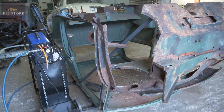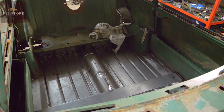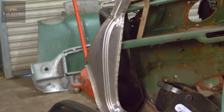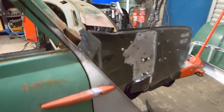While it was on its back, on its roof, laid the floor in, cleaned up all the areas on the back that had to be spot welded, cleaned up all the areas on the front that had to be spot welded, removed all the old metal from the floor, fitted the front and rear subframes so I know it all mounts squarely and properly as it should do on all the rest of the mountings.